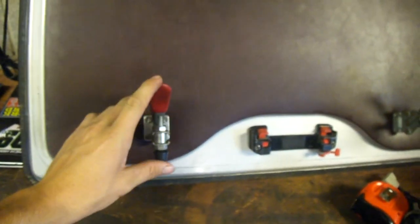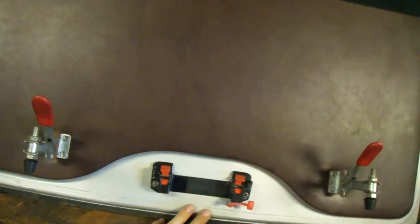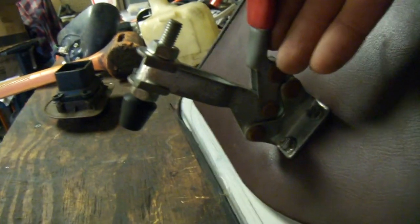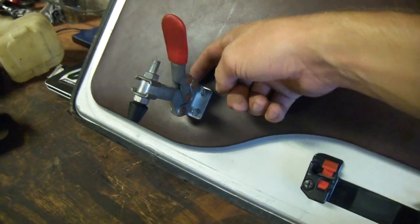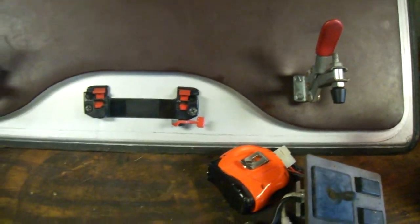This latch is busted — the spinny part — which is this piece. The spinny part was busted so you couldn't lock it down. You might say it's locked to the sunroof so you can only open it six inches, but I could literally just take the sunroof out. It was nice though because if I locked my keys in my car I could get them. So right here, this is your standard Harbor Freight clamp latch. When you push this down, it locks down like that and presses against the inside of the roof, holding the sunroof in so you can't remove it. Self-tapping screwed in here — I pre-drilled the holes. These are really short screws but they go through the panel, one on each side. That's how I was able to lock my sunroof. If you have a glass one, you can't do that because you can't put drill screws in the glass.